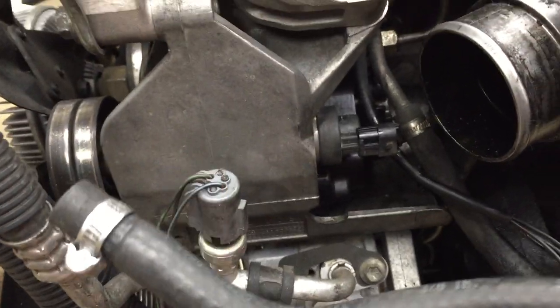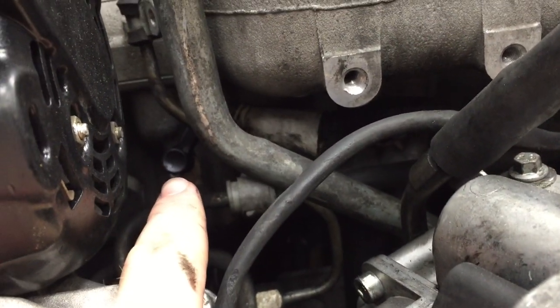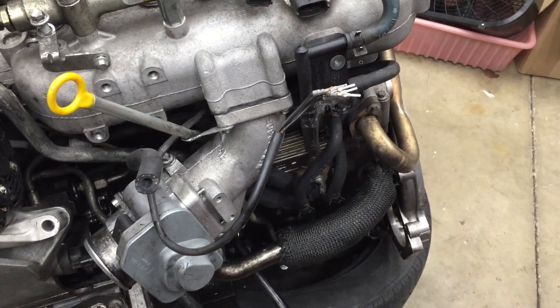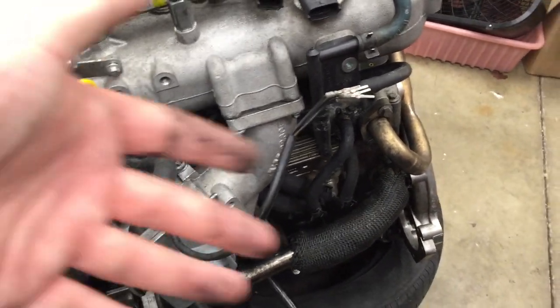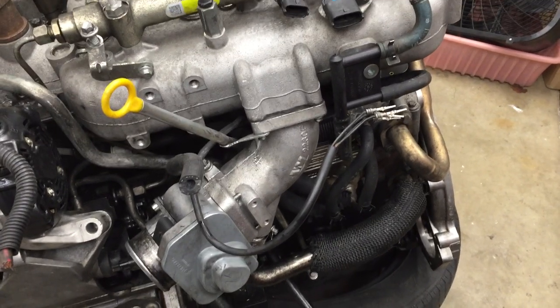The glow plug harness runs underneath the intake manifold — number one, two, three, four cylinders. The engine doesn't even need the glow plugs to start above about 50 degrees. You can start without the glow plugs plugged in down to about 40 degrees or so, though your start might be a little slower without them. Right now it's about 50 degrees in the garage, so I don't need glow plugs to start it. The glow plugs could all be bad, the glow plug controller could be bad, and it should still start. They really start to make a difference below about 40 degrees, and especially down around 30 and below, you really do need the glow plugs.